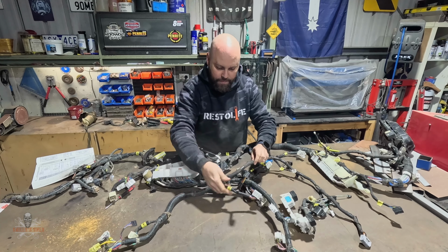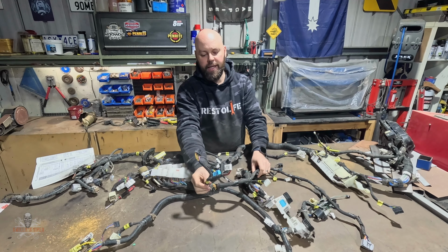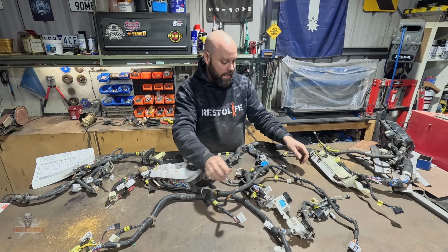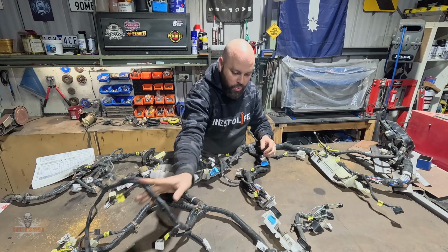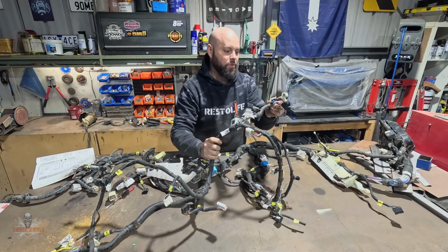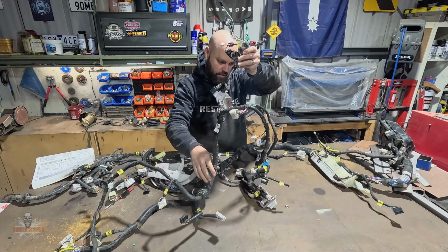And then the instrument cluster, so the only thing that I'll need out of that is a tacho wire, which I'm going to use a Dakota Digital converter for, which I'll talk about later. So I don't need any of that. Then that's all speaker, that all goes to the door. And then this is all stereo, cigarette lighter. So that's all that can go away.